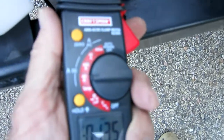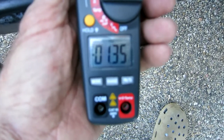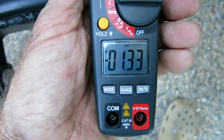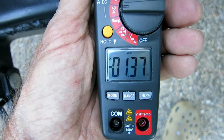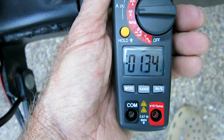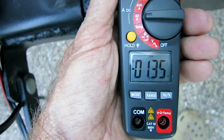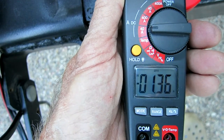What's nice too is you can see what you're taking out. Right here I've got a couple of things on in the RV — mainly the refrigerator, which is about a quarter of an amp. I've got the strip disconnected and the humidity strip. I just turned on the water heater, and that's the majority of the amps right there. Even though it's gas, it involves a 12-volt solenoid.